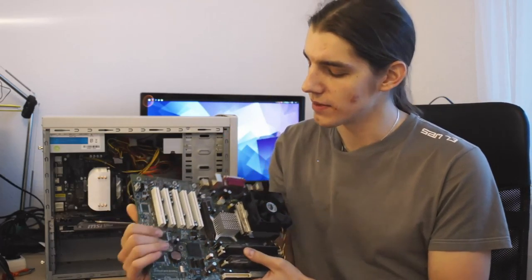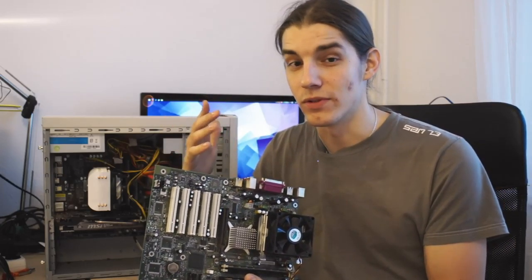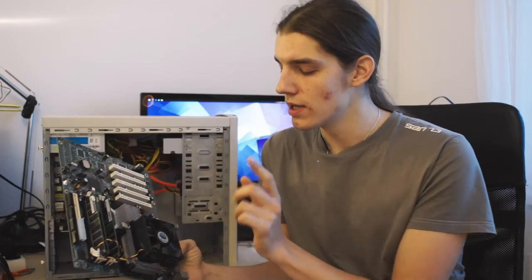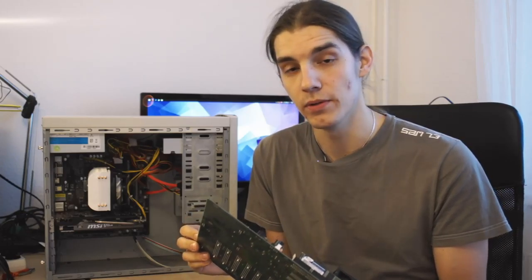We were also not able to simply put in just the graphics card, because you can see on the old motherboard there is no PCI Express slot, this is only an AGP slot, and there are no reasonably good graphics cards made with an AGP socket. We might now actually be able to sell the old board with a CPU and the original GPU and Ethernet adapters for somewhere around, let's say, $20, which will again give us some more headroom for a better GPU.